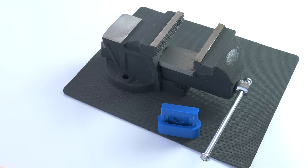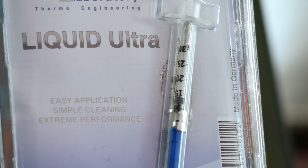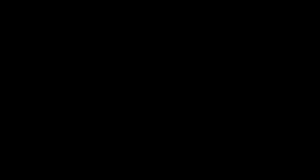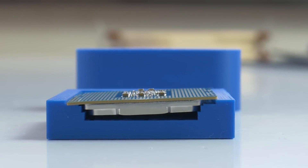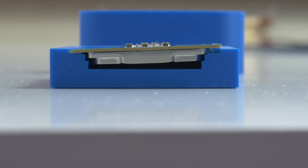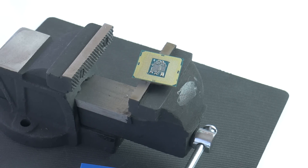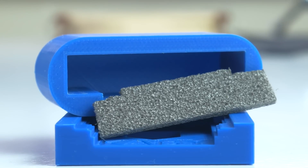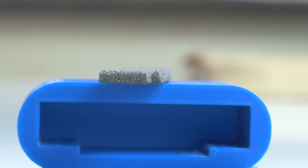For this, you'll be needing a 3D printed tool and a vise, which you can also get for around $15 — just make sure it has at least 3 inches distance between the grips. You'll also need CLU, that's Cool Laboratory Liquid Ultra, a gallium liquid metal TIM to use between the bare die and the underside of the IHS. You can use other gallium-based TIMs but CLU works best for durability. For the 3D printed tool I used a PU polyurethane gasket so the CPU PCB wouldn't hit the ABS plastic directly — thin rubber works fine too.